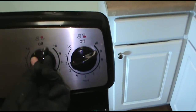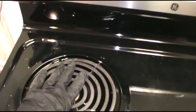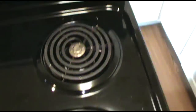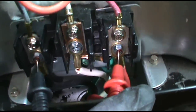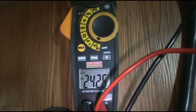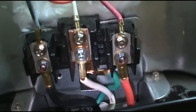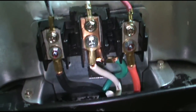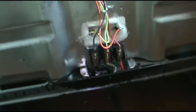Check the eyes. This is the switch that I replaced — make sure the burners are getting hot, not throwing any breakers. Good to go. Alright, I'm just poking around on it with my meter, making sure I'm not getting any kind of crazy voltages. 242 volts — that's good. Like I said, I've seen this before when I was working in student housing and it was knocking the power out to the whole apartment. The 200 amp breaker feeding the apartment was popping when the oven would turn on. Really weird — could have been the switch up here, it was all charred. But they're good to go now.